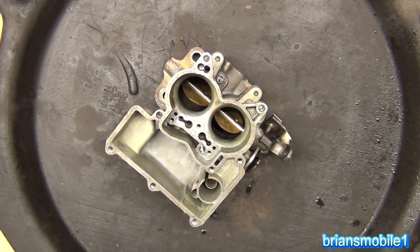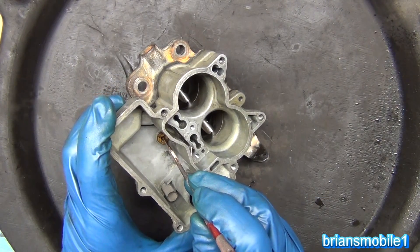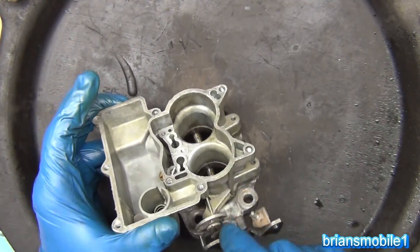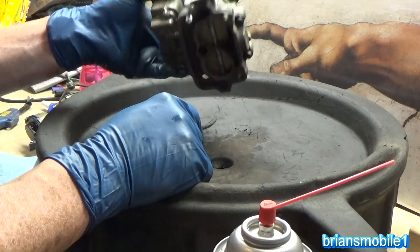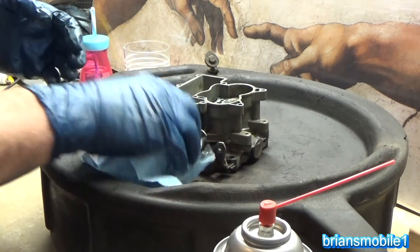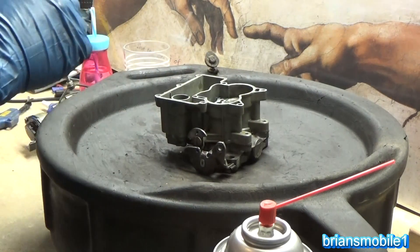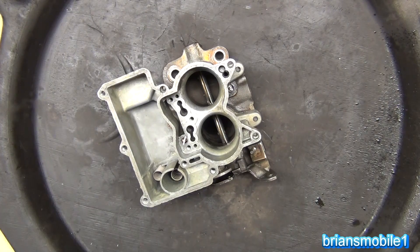That's how carburetors work. As the definition implies, a carburetor is an ingenious method to crudely meter fuel. Basically you need 14.7 parts air to one part fuel, and the carburetor uses the Venturi principle to meter however much fuel you need to make that stoichiometric balance so your vehicle runs well. Thanks for watching — if you'd like to see more videos like this, please click subscribe.